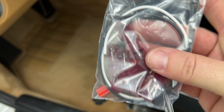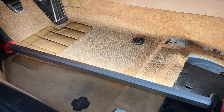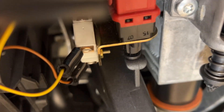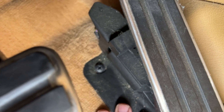This is what our T-connectors look like — essentially just a really easy way to splice one wire into another existing wire. Since he doesn't have an airbag, it was easy to knock out four bolts and pull the seat out so we can get access down here a lot easier. Here we can see our clutch pedal. The white thing is the bottom switch and the red one is the top switch that they keep talking about. Under the accelerator pedal is the wiring right back here. There's one Phillips screw here that we're going to remove and slide this cover off to get a little better access.